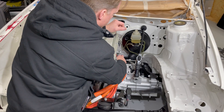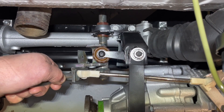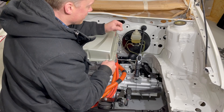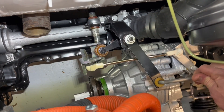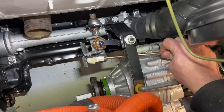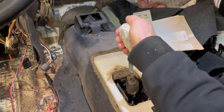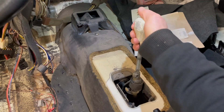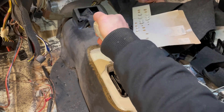I have also connected all the links to the shifting of the gears, so now that is working. It actually takes some time to get the gears working correctly because it's very fine tuning stuff. If you put in the first gear and it works really nice and easy, you will not be able to engage the fifth gear, so it's important to be right in the middle with the adjustment.